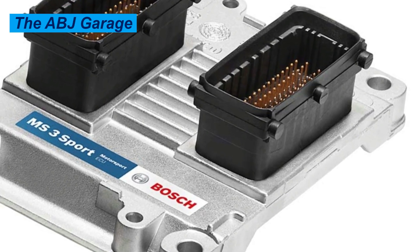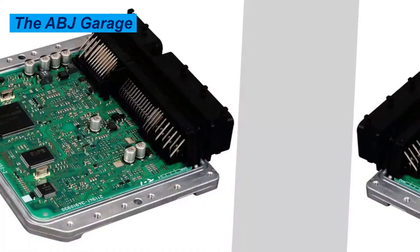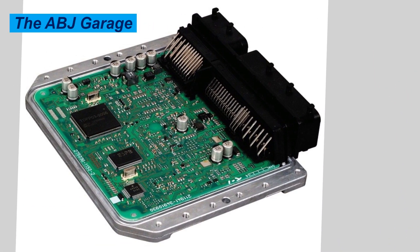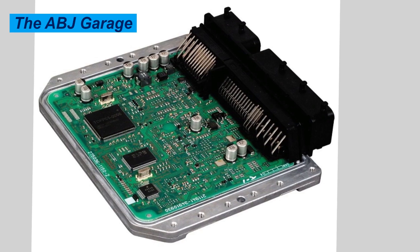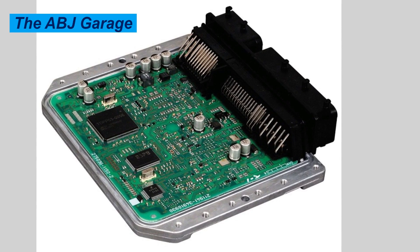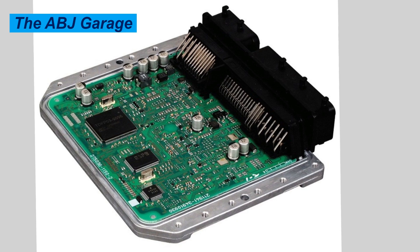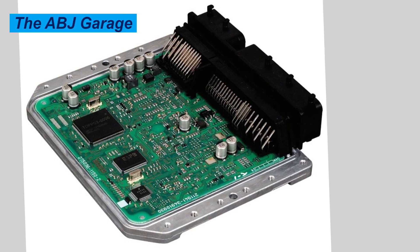If possible, take the car for a varied drive — city or highway — for about 10 to 20 miles. Use gentle acceleration and deceleration. This will allow the ECU to relearn fuel trims, shift points, and other adaptive settings. This works for the majority of vehicles. That is the number one method: the battery disconnect method.